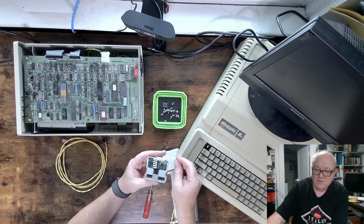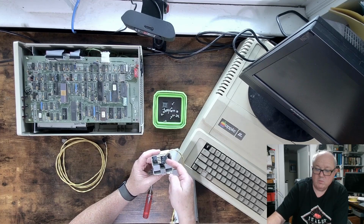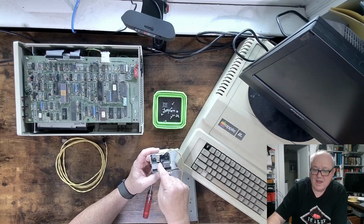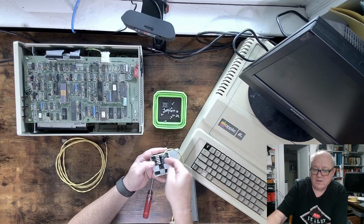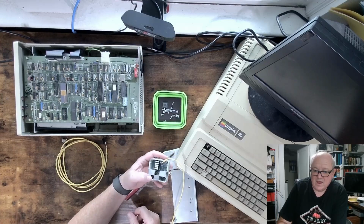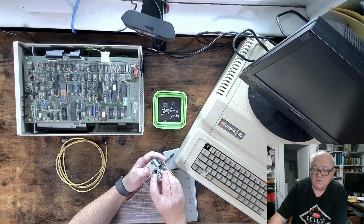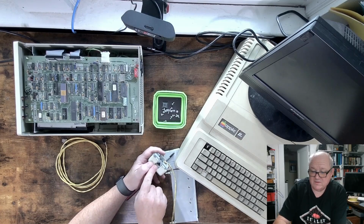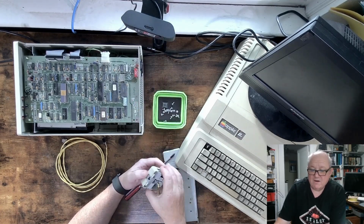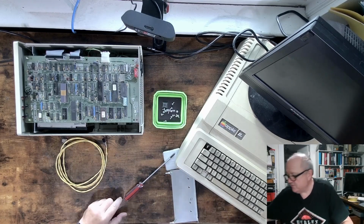The other thing you have to do on the network I mentioned, you have to put a 100 ohm resistor at each end to tell us the end of the cable. And this again made it real easy to just stick that resistor in where the next daisy chain cable will go off. And I do have 3 of these RJ45, and that is a standard RJ45 drop cable that plugs in there. And I have RJ45 connectors, so I could make more of those if I needed to.